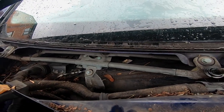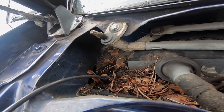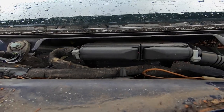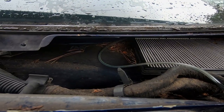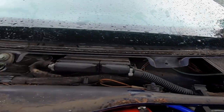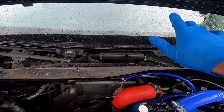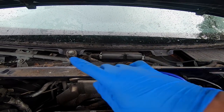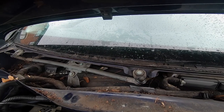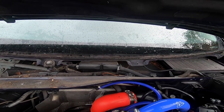That's now been removed. As you can see, everything down here - you've got your wiper motor and wiper arm linkages. There's the cable for the bonnet release down there in the corner, the ECU in the middle, pollen filter, and there's my boost gauge vacuum hose. I'm going to be pulling all the leaves and bits out of here, seeing what I can find, and sealing up any openings. When you want to remove that panel, the best thing is to remove it up towards the roof of the car, up towards the windscreen, because it's bigger on the corner and the bonnet gets in the way.